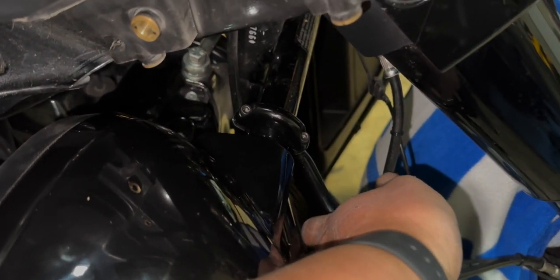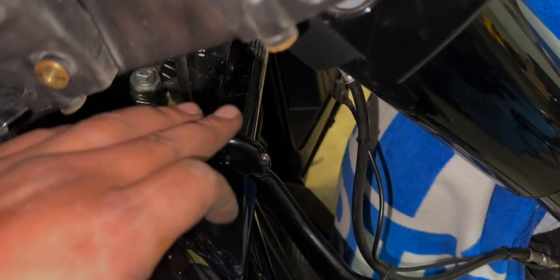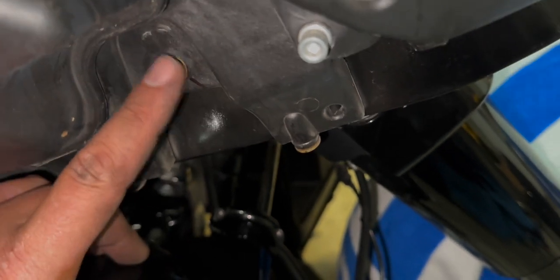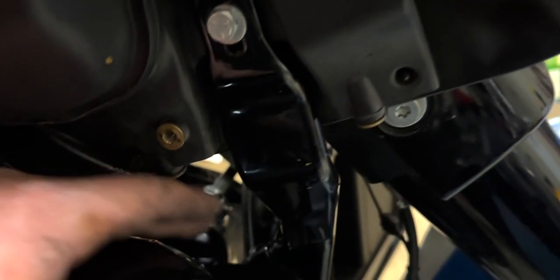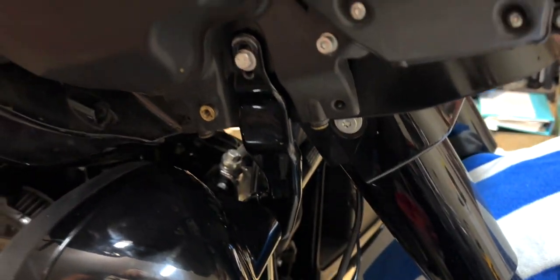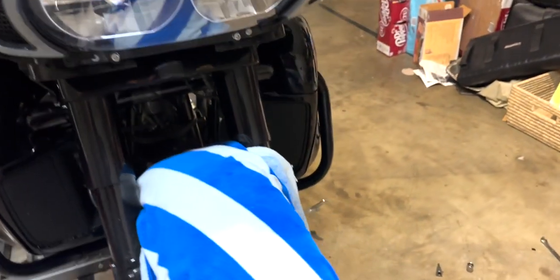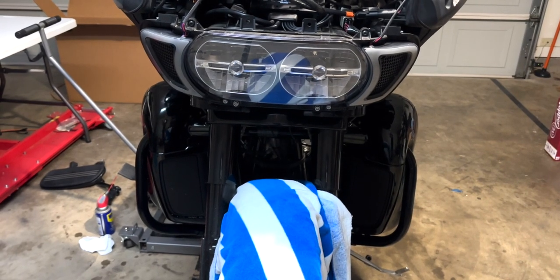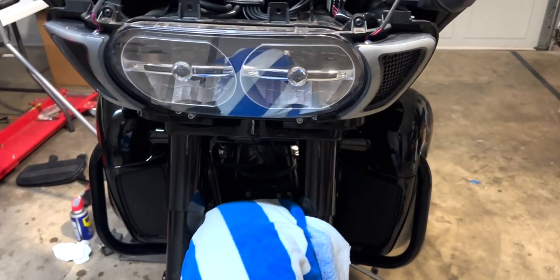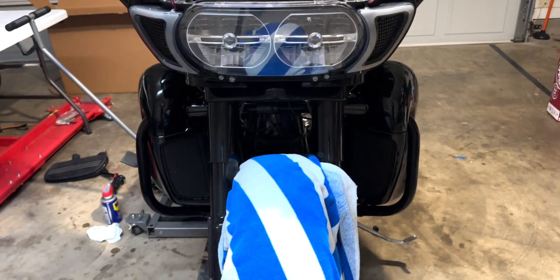Here's a tip: if you already put your lower fairings on first like I did, you can actually just hang the bracket like this and put those two back screws in much easier, then leave them loose and attach your top one. Got the other lower fairing bracket on — 11 millimeter up top and 5/32 Allen for the back. It's easier to put the brackets on first then do your lower fairings, but either way that's what they look like — pretty symmetrical, pretty good. They do an excellent job keeping wind off your legs, feet, and toes.